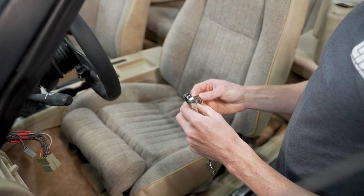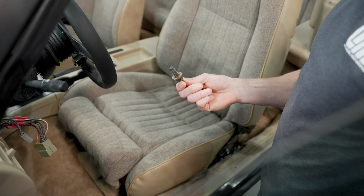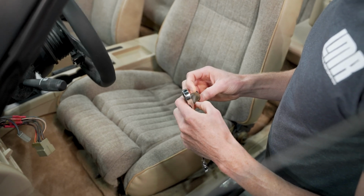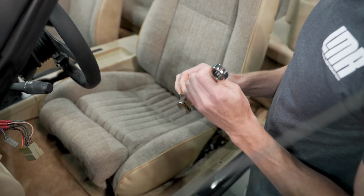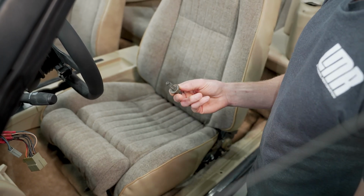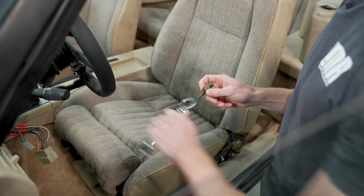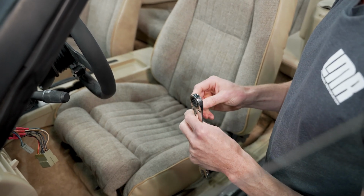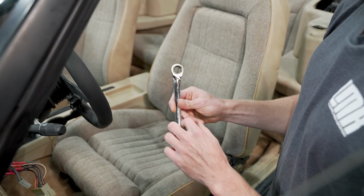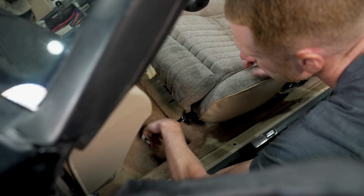Okay, so typically what can happen when you're removing the front nuts is the entire stud comes out. If you wanted to fix this, you kind of would need to jig this up, hold this with like a jam nut setup, and then break your nut free. Typically, why this happens is these nuts get way over tightened. The next time you go to remove it, it pulls the entire stud out. And then typically what I find the easiest tool to use is just a 15mm ratcheting combination wrench.